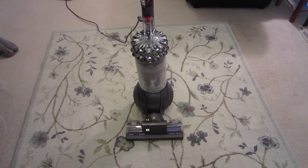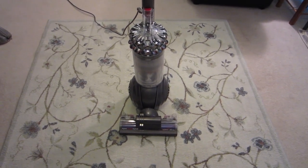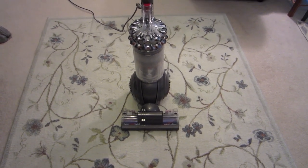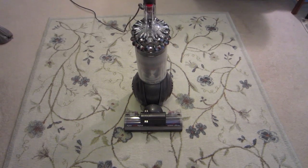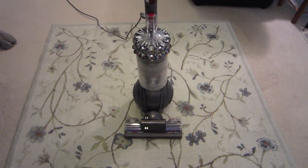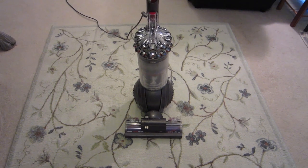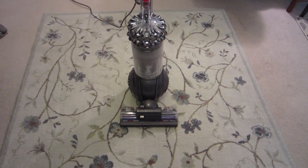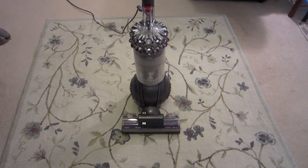To start off with a little backstory on my side of things for this model - Dyson. When I heard about these coming out, there were a couple things that came to mind. My first was that this is probably going to crash and burn, because normal Dyson machines that are multi-cyclonic let through so much dust to the pre-filter that it is a pretty large issue, even though they're one of the better companies as far as bagless filtration goes. The second was that maybe, if it works, this might actually be interesting in terms of almost a return-to-Phantom type deal, with having no filters to bother with and truly no loss of suction, even if you never did anything other than empty the bin for three years. And then the reports of motor failures started trickling in, and I came to realize that my first assumption on this was the correct one.